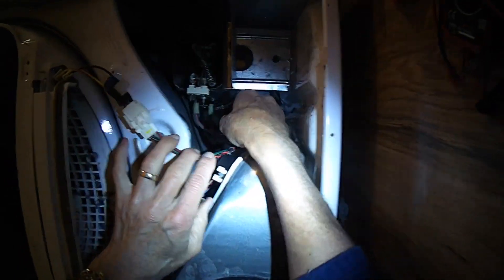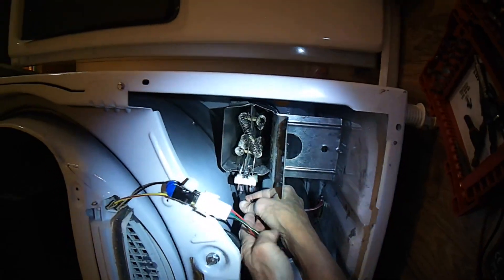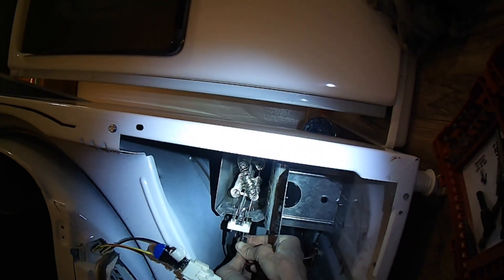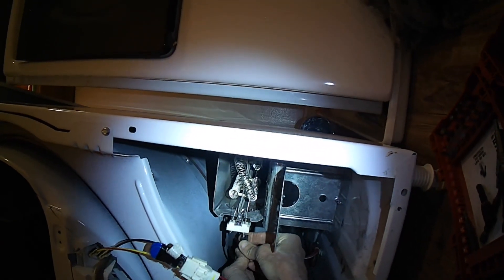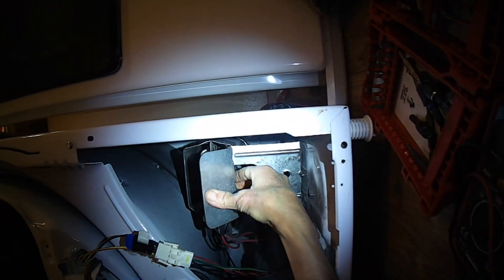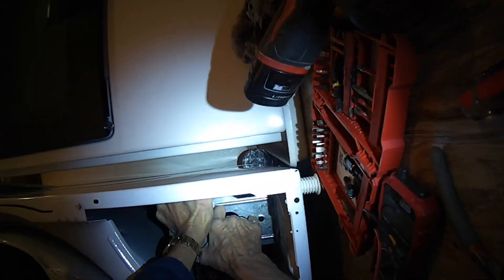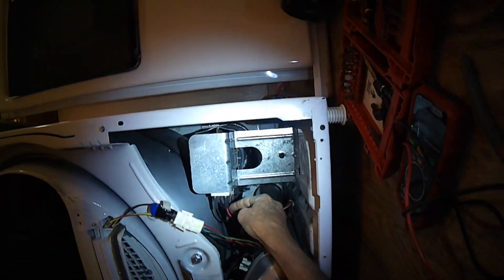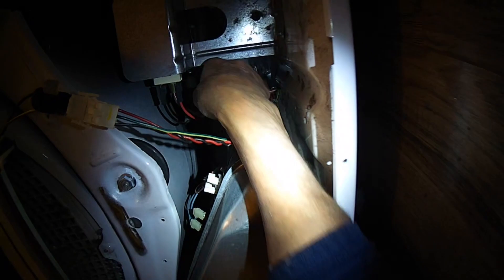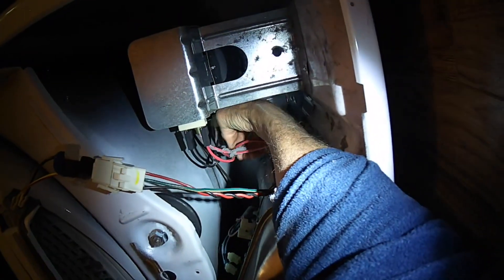Here's the new element. We're going to clean out the housing a little bit first — you can see accumulated lint that caught on fire, but you want to get it as clean as you can to reduce the risk of fire. There's lint on top too. Before installing, it's good to check for continuity on the new element — that one's doing great, no breaks in the spring. Also check to make sure no metal touches the frame on the springs; they have ceramic insulators, but verify because metal touching the frame will cause it to run full blast and won't last long.